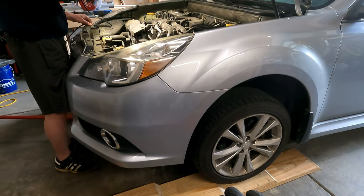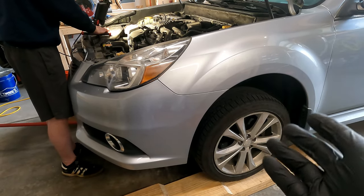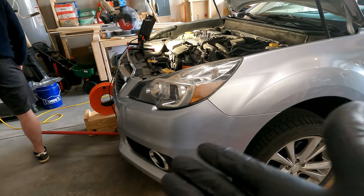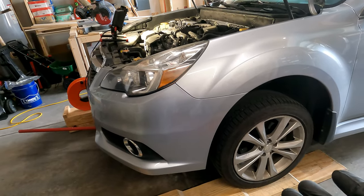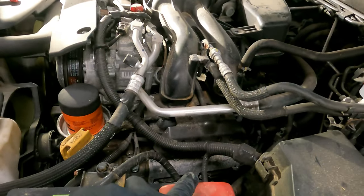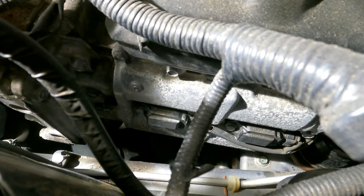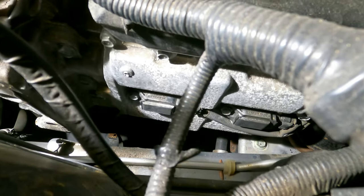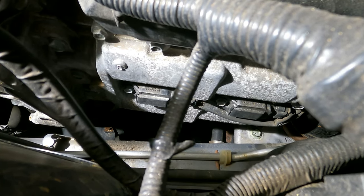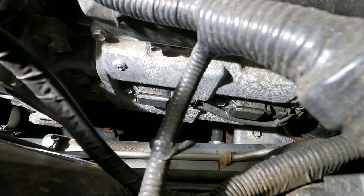Some advice: when you start jacking up the motor, the suspension is going to raise a little bit as you lift. So you really need to watch the studs while you're cranking and make sure you're not actually lifting the vehicle off the ground. Now that we've done that, we can try to get access to the coil packs on the sides of the motor. We've got the two spark plug caps held on with a 10 millimeter bolt — remove those bolts, then pull the coil pack out from the top of the spark plug to get access to the spark plug itself.